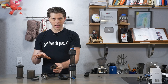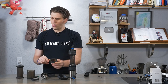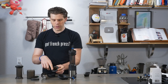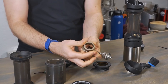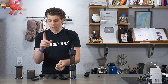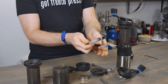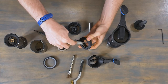This could definitely be bad down the road — it could lead to degradation of the device, and potentially that could get into your coffee grounds. So what we suggest is: don't run water directly into the device and then leave it to dry. If you do that, water can pool up over time and cause rust to build up. I also have some rust that has built up on my burrs, and some water staining. Water staining is not too big a deal, but rust could definitely be a problem over time. There is a brush that comes with the device — included with the Lido — but I also have some extra brushes for cleaning the rust.